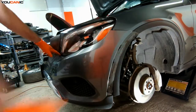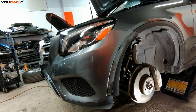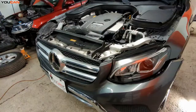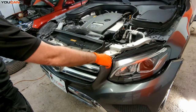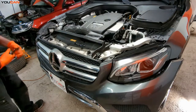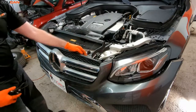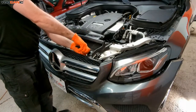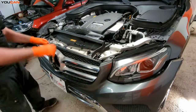We need to pull out, holding this trim piece out and pulling down. There's a little tab up here — pull down the bumper a little bit and then pull out. Everything looks good with no electrical connectors to worry about on this side. It's just the one electrical connector on the other side. To get the rest of the bumper off, there are two size eight bolts and some push clips here to remove from the inside near the radiator portion.